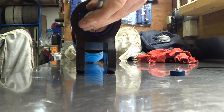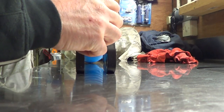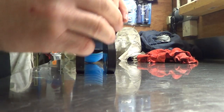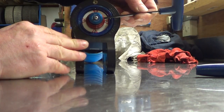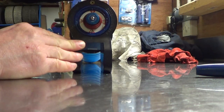Now come out onto your adjuster — you can feel your adjuster rotate back and forth. Now put your low speed rebound blue knob back on again, allen key in. Your 3mm to hold it, your 2mm to tighten it up. Now you can load your settings back in again — it's on zero. So you can turn it to 1, or 2, or whatever you want. If you've gone to 2 and you want 1, don't turn it back — just keep going in the clockwise direction, round to 3, back to 0, and up to 1.